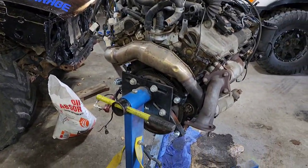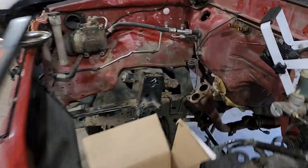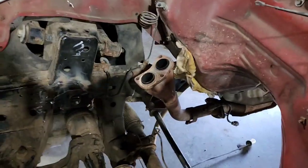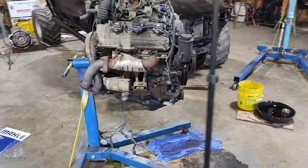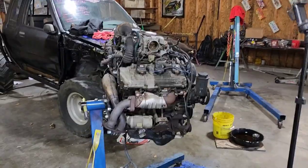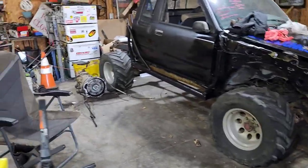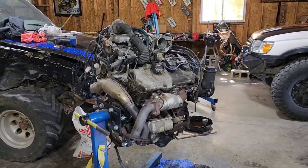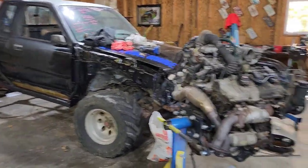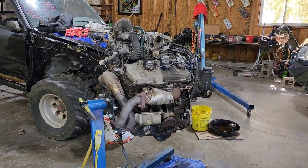You get the idea. If this was in the vehicle, at least now you know where all the bolts are. Got to get this welded up in here, drop the exhaust, change that power steering line — that'll be the engine install video. She's ready to go back in now. I'll put the transmission and transfer case up after the engine, as opposed to trying to get the engine to meet them. I think that'll be the easier way to go about it.